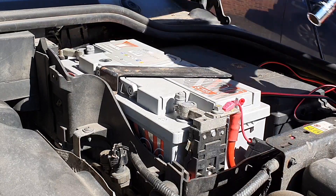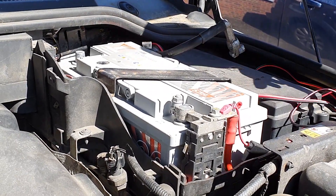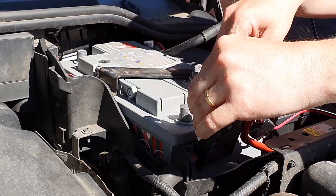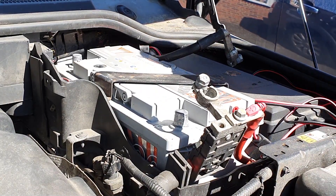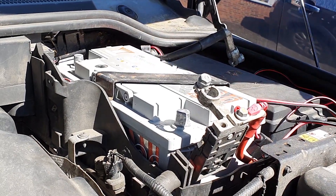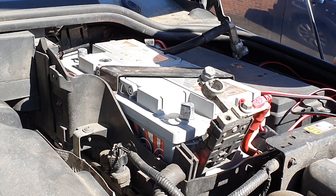You don't need to take the nut off entirely, you just need to loosen it sufficiently so that you can pull the terminal off in one fell swoop. Try and do a nice clean break rather than hovering it around because you'll get a lot of arcing. Make sure that's nice and clear. Loosen the positive as well — it will pop off. What we're going to do in principle is connect the positive cable and the negative cable together — but not the battery terminals themselves, that would be a disaster. We're not going to do it for at least 10 minutes; you've got to let any residual current in the system drain out. There are capacitors all over the place in the electronics — just let it die down and settle. Give it 10 minutes, then we'll connect them together using a jump lead.